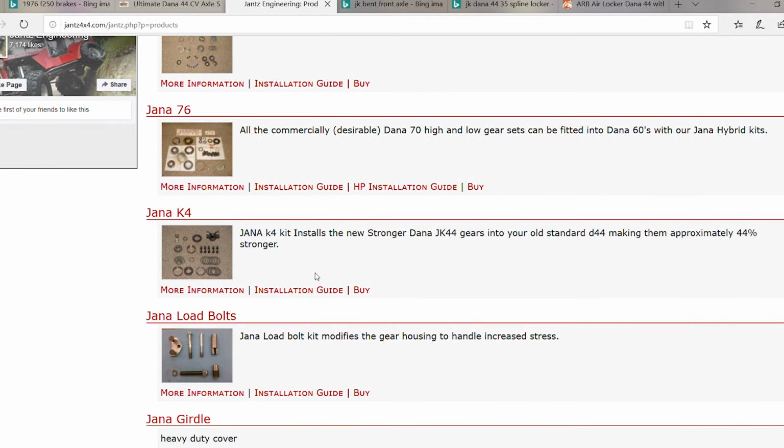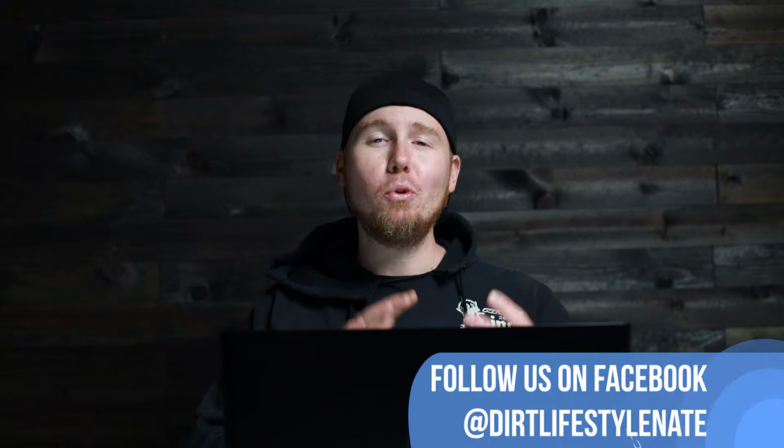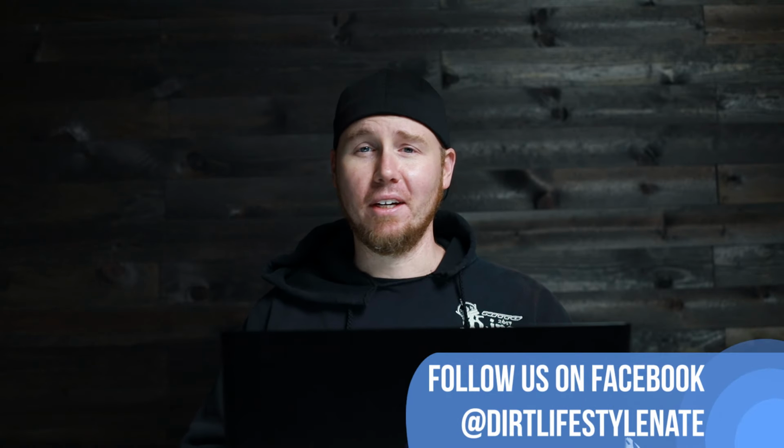Pretty incredible. I think this is a great option, but there is something I do think is better. This is the Jana K4 kit. The Jana K4 kit makes it to where you can put JK Dana 44 ring and pinions into the older Dana 44 axle housing. This is awesome because the JK Dana 44s actually have a larger ring and pinion than the older F-150s and F-250s.